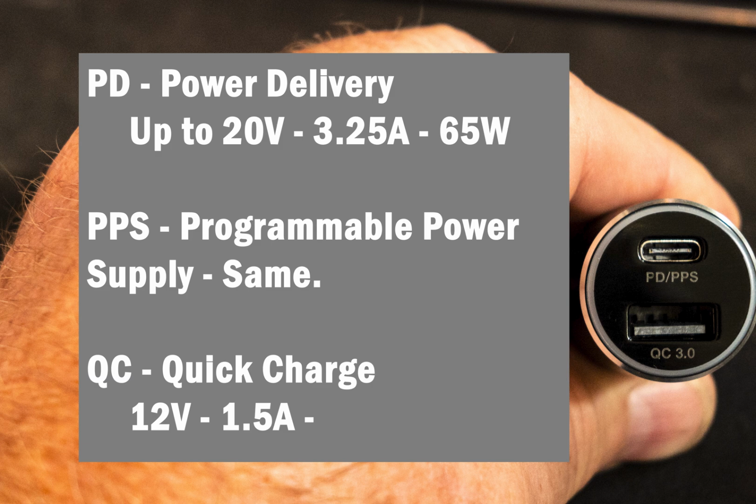With PD though, and the correct USB-C cable, you can leave the bulky laptop charger at the house. Power delivery also monitors your device and the battery and prevents overheating and other problems, which increases the battery life. But be aware, some devices don't support PD. You'll still charge, just not at the 50 to 70% reduction in time, and most likely limited to 5 volts. Most devices that support power sharing, most Samsung devices, also support power delivery.